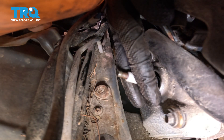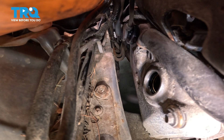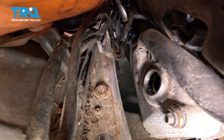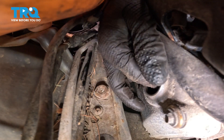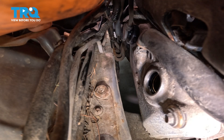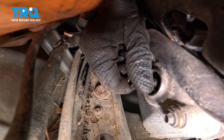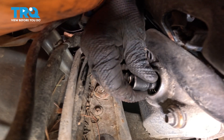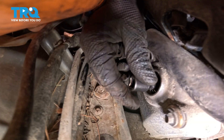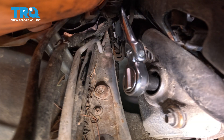Take the new spark plug and very slowly slide it down in, unless you can fit your whole socket and extension in here. Get the socket in with one extension, get that seated, then add the other extension. Get the socket in and try to get this threaded in by hand. Here we go with that half to two thirds of a turn.